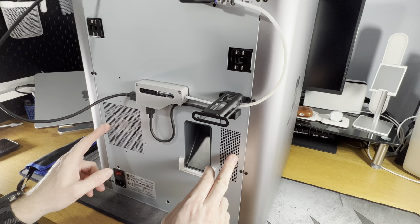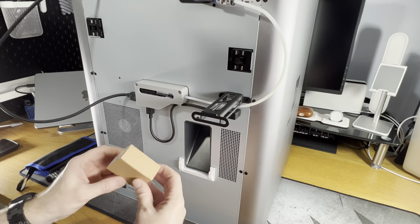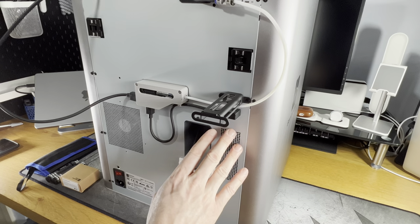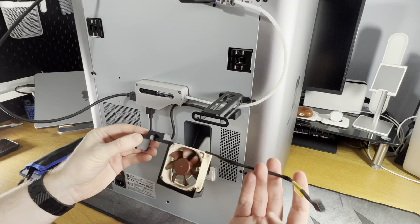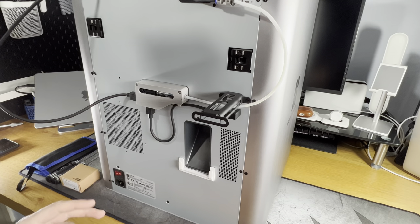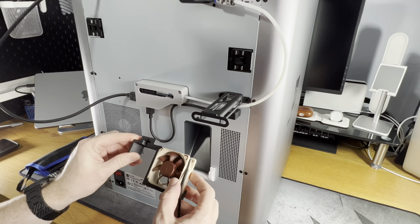We're going to remove the back cover, remove the existing fan that's making the noise, and replace it with a new fan. This fan is from Bambu Labs directly — it's a spare fan. We'll install that, test it, make sure it works, and potentially look at a custom replacement fan. The custom replacement fan is this — it's a Noctua fan with an adapter. It would sit somewhere in here. And if that works out, we'll replace that too and maybe get some better cooling on the main controller board.